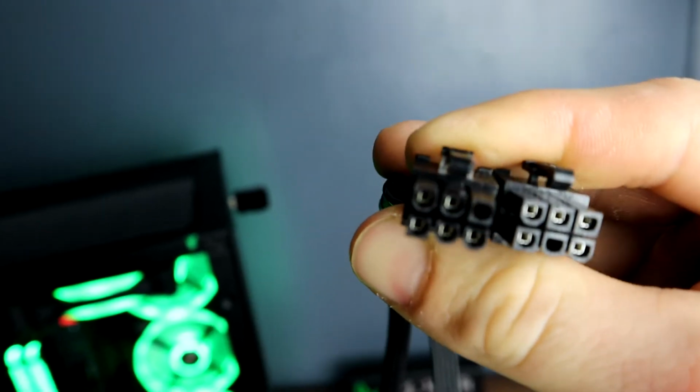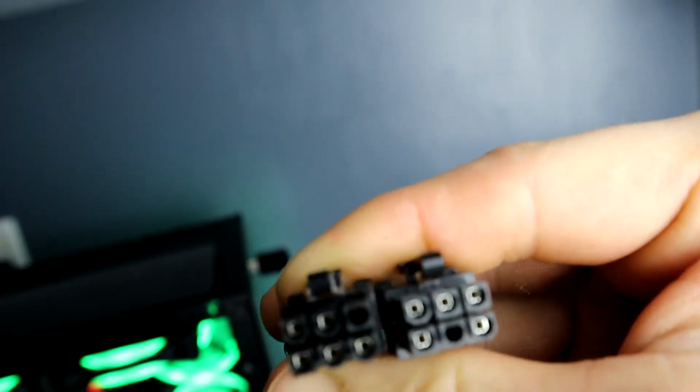Now if you're still confused about how I burnt my hard drive up, good. I'm about to teach you a very important lesson. Never ever mix cables from 2 different power supplies. They are not interchangeable. You see, if you look on the inside of 2 different power supply connectors, they are not the same. Now because the pins on each cable are different, you could be sending a 12-volt rail to where a blank is supposed to be. As you can imagine, nothing good can ever come from that.